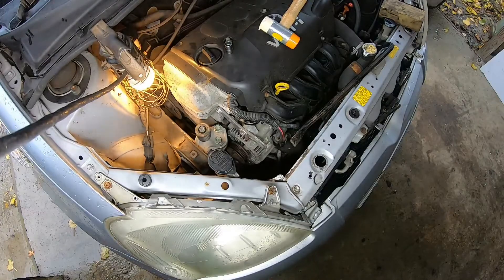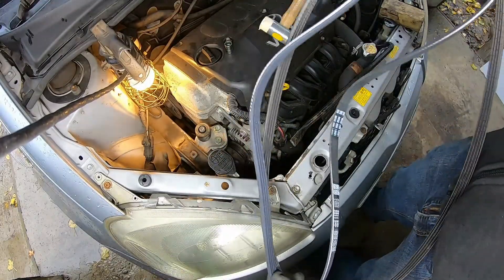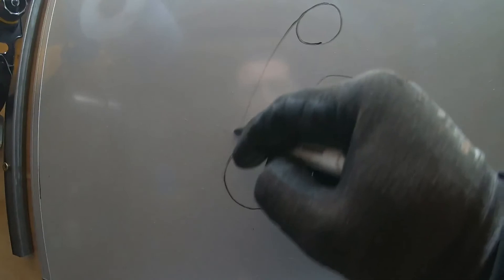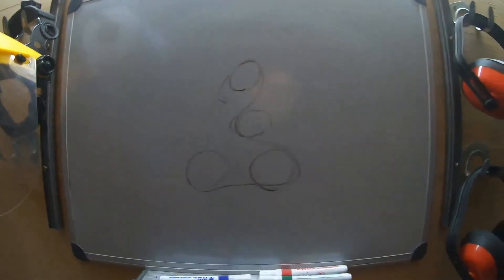I've got the new belt. I'll put both belts side by side just to double-check — they should be the same length, which they are, so that's great. Now let's get on to getting that on. On this car the belt goes around the alternator up here, the main crank pulley, the AC compressor, and then the water pump. The belt goes down and around and up, and it actually rests the backside on the water pump. Make sure the ribs are facing inwards towards the pulleys — the smooth side of the belt will rest on the water pump pulley.